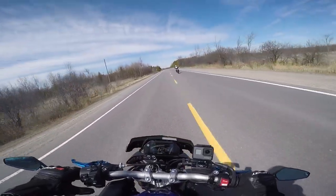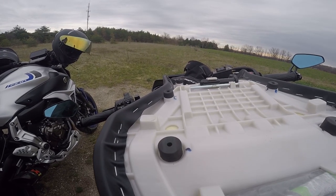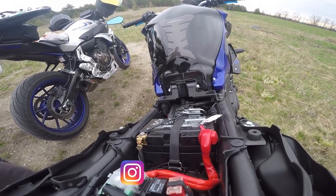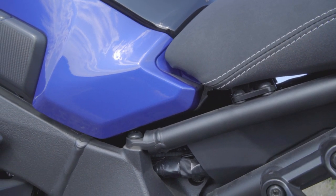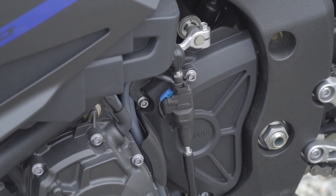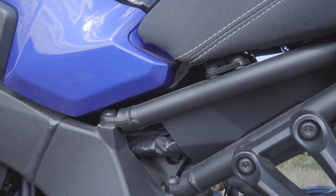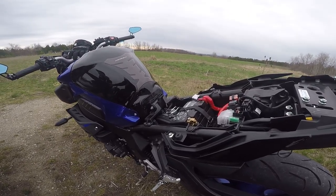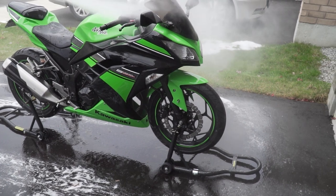When I'm riding the bike I can't really feel the seat moving underneath me because there's quite a bit of weight on the seat. And if you're concerned about this problem, don't be — this bike has been on the market for quite some time and Yamaha recognized the problem and did nothing to correct it. Another issue is the hole between the bike and the seat. I'm not a complete expert on naked bikes, but I know a big point is to expose the frame and engine for the raw look. I'm pretty sure the ABS pump is not part of that raw look. All the internals will collect dust much quicker than other bikes like the MT-07, and if you like to pressure wash your bike, be really careful otherwise your bike might drown.